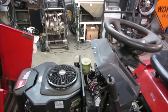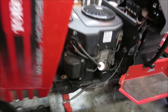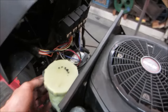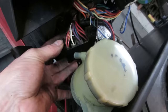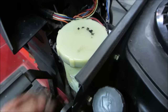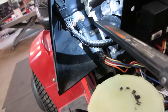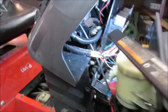Let's go give her a quick visual walk around. I see the fuse box is hanging on the other side — somebody's been poking around on it to see what's going on. Let's pull the back panel. I can see wires ripped out of it. Let's test those fuses and get a light for a better idea of what we've got. The ignition switch looks very clean — usually that's got a lot of corrosion on it. I don't see an issue there. It has a bunch of relays, probably used for interlocks.